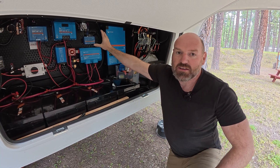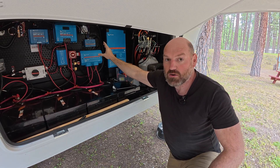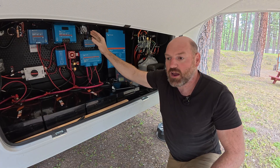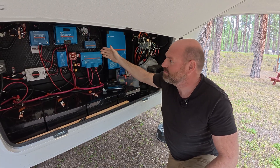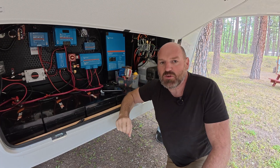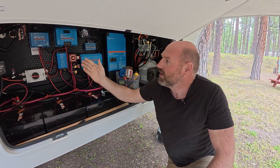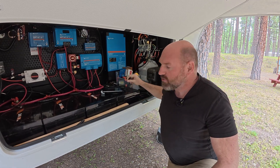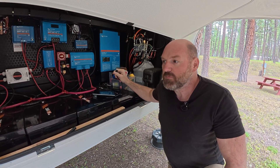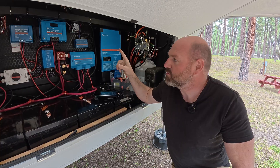What I've got to get done is run an HDMI extension from here up and through the basement, and then we'll need USB power to power this unit. HDMI extension cables don't typically have USB power and there'll be voltage drop over that length. Most people recommend keeping the factory length of USB power as close as you can to the display unit.